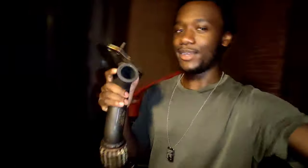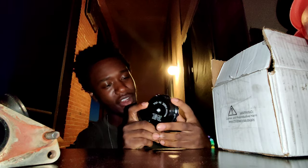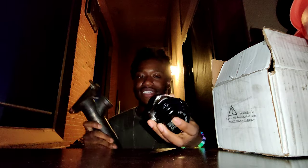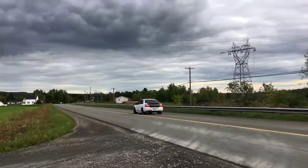I also have the Grimmspeed uppipe with the 38mm wastegate on it. Wait till you guys see this one. We got ourselves a Tial 38mm wastegate finally — after all this time of having it and just not putting it on, we finally have it and we're going to start making the noises that I want to be making. My only concern is figuring out the proper dump tube size and angle so it can go over my axles without any fiery problems.